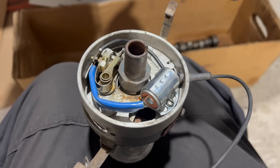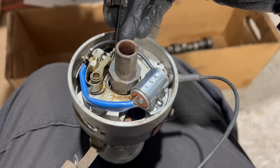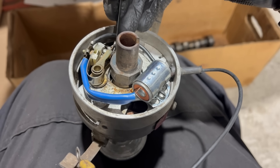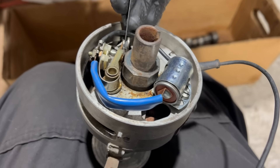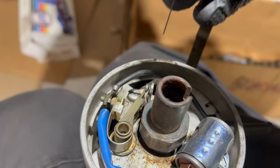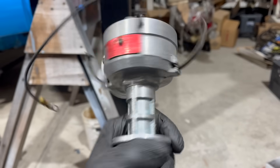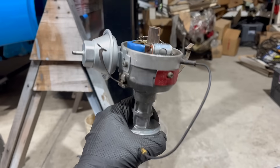Sure is easier to check the points gap like this. Now, unsurprisingly, because I pulled this plate out of another body, that's no longer set correctly — it might not have been set correctly to begin with, now that I think about it. Nailed it! Nice. Not perfect — we don't have that kind of time — but looks pretty good.